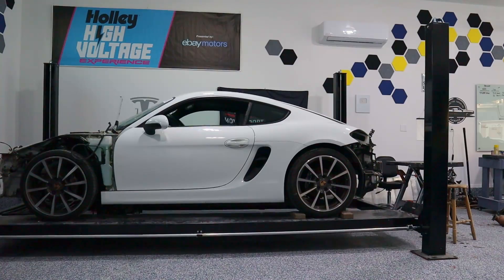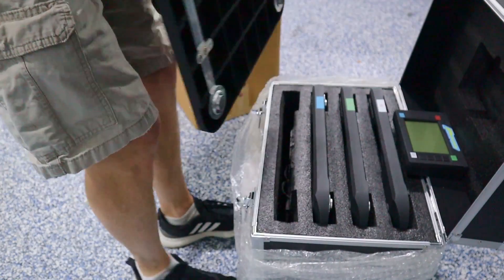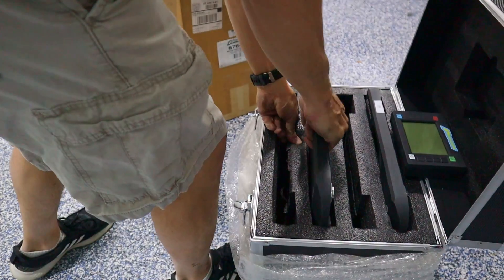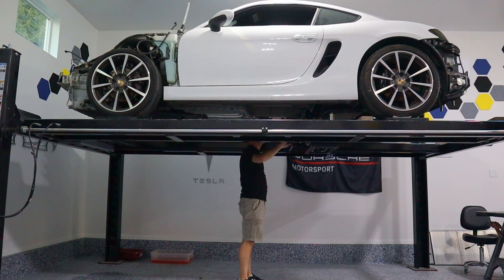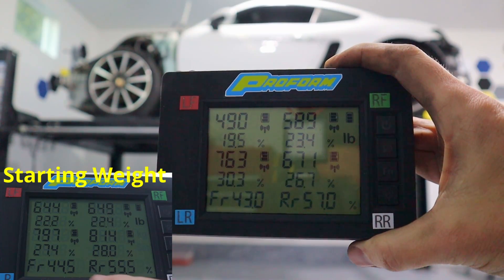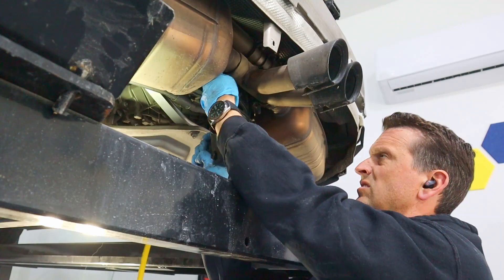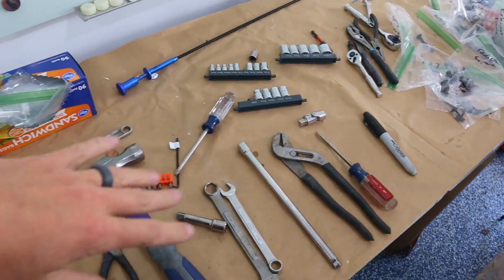Here at the end, we're going to see how much weight we've taken off, so we're going to get the scales out again. There we are — 2,510 pounds. Now it's 43% front, 57% rear. So we're going to call that one back-end disassembly — besides the trunk, we accessed the engine from on top as well as the bottom, and took out the exhaust as well as a lot of the coolant. We've got parts all over the place, everything labeled.